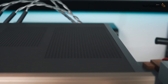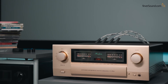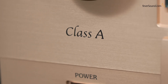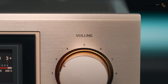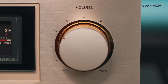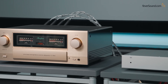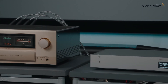I always mention a product's shortcomings, and this unit is no exception. Class A is its strength but also a limitation. Although it outputs 70W at 4Ω, power is still an objective number. When paired with speakers below 85 dB sensitivity, or in a space larger than 200 square feet with a longer listening distance, or when listening at higher volumes, this output may reach its limit. This kind of issue is unlikely with high-power Class A/B amplifiers — switching to the Accuphase E5000, for example, eliminates this power limitation.